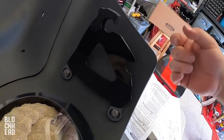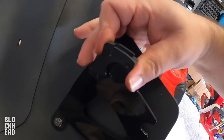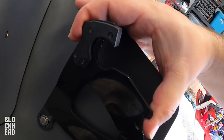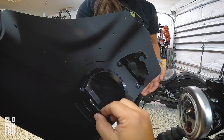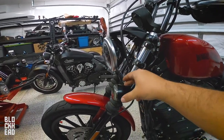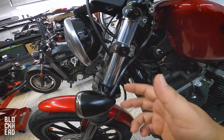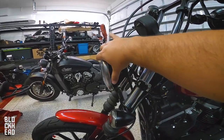After the brackets are mounted, we're ready to put them on the forks. Open up the trigger locks — you pull outwards and press back to open them up, then whenever you close them they come down and latch so they don't go back up. Tighten them down. Fun fact: with the relocation brackets we were actually able to relocate Anna's signals from the upper position down to the bottom of the triple, which is cool.